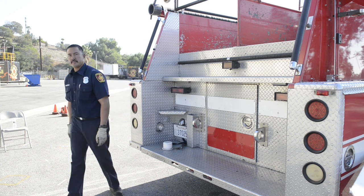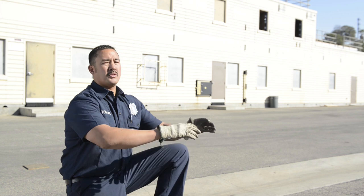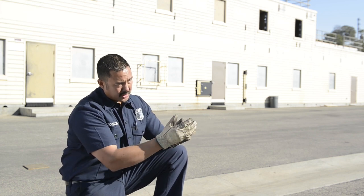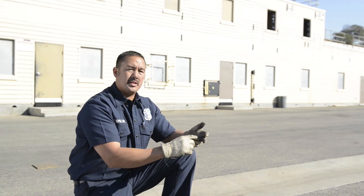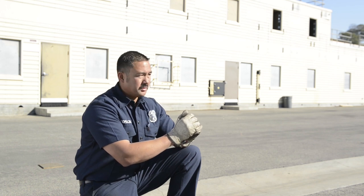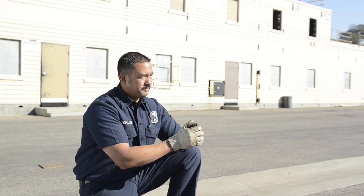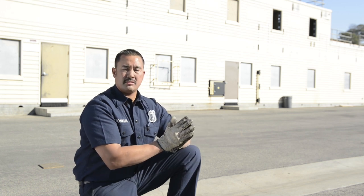Now stepping back to get a better view of the rear of my rig — from this vantage point, take a look at the overall appearance and make sure it's not leaning to one side or the other, which may be a suspension problem. Check underneath the rig for anything hanging like belts or mounts. On the ground, look for any leaks, puddles, or bolts or mounts that may have fallen off. From this vantage point I can also see my fuel tank — checking for dents, leaks, or damage, and making sure the straps are secure and present. Mud flaps should be present, not torn, and hanging down at least two-thirds of the way. I can also see between my duals — make sure there are no foreign objects and the tires are not touching, which may indicate low tire pressure.